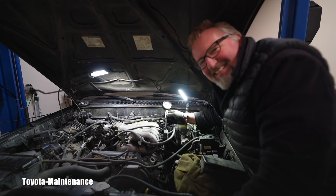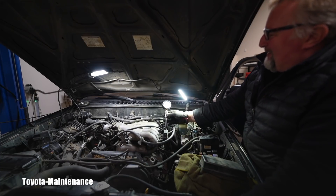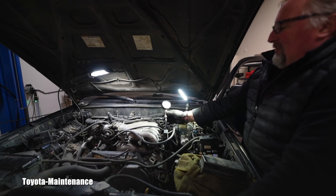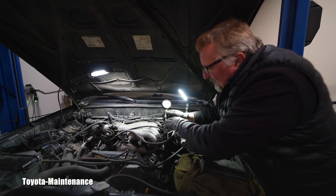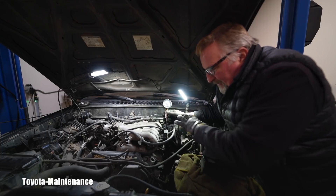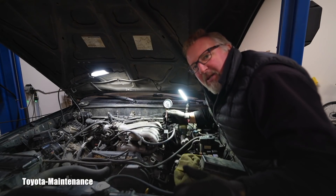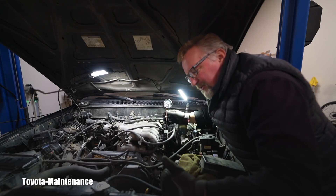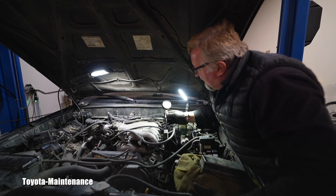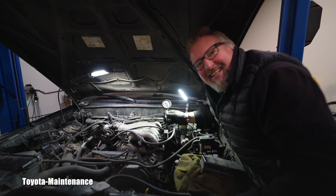Isaac is a lucky boy! He has the biggest compression on number four - incredible 220 or 225 PSI. We will not have a problem on number four because of the compression or a blown head gasket. Some of you said there was missing coolant - well, he just brought it in, the previous owner never put coolant in, so we filled it to the F and when he came back today it's still on the F. The coolant is not disappearing. Number four has 220, or more likely 225 PSI - great news for our young master Isaac.